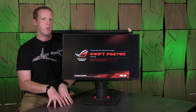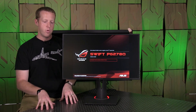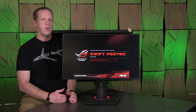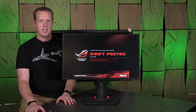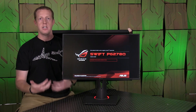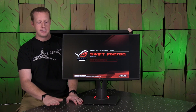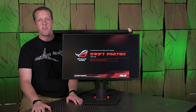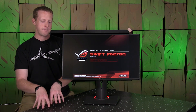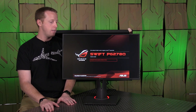As a caveat, people who have been using 120 to 144Hz monitors for a while are already seeing some of the benefits this monitor provides even without G-Sync. G-Sync is much more of a world-changing feature at lower frame rates, say 40 to 70 FPS. Once you get above that, horizontal tearing is lessened especially at 144Hz, where any tearing is on screen for an exceptionally low amount of time. But G-Sync eliminates it completely — and if you're coming from a 60Hz panel, you'll get the full benefits of both 144Hz refresh rates and G-Sync.